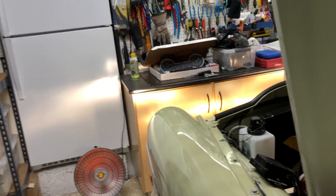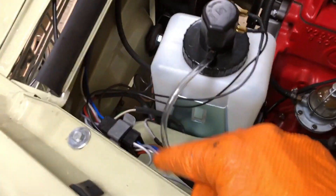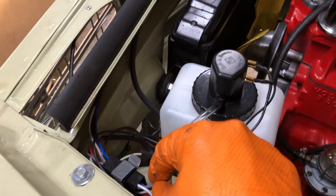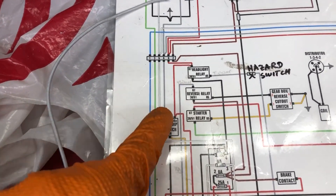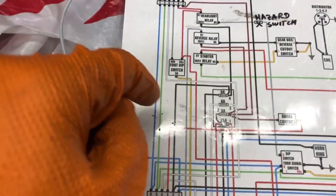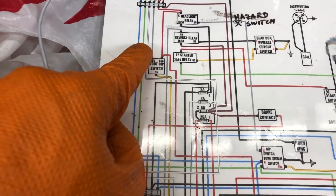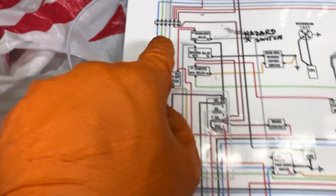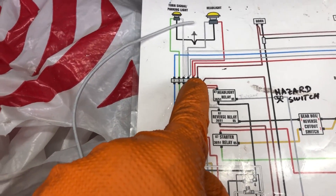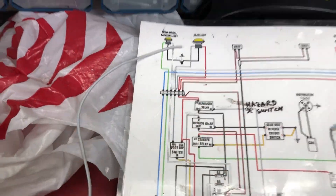Let's go turn these on and look underneath. The two whites — one of them goes to the gray wire. That's the important thing. If you want your trigger, this is where you can find it, or you find it underneath the kick panel switch, which is the foot dip switch. I've connected it here to number four because it was easier to get access that way and I didn't want to pull back the carpet. That's probably an easier method if you've got carpet that's easily removable. You can't go to the relay for the headlights because that gray wire goes to something else entirely. If you connect to the reds, your fog lights will turn on with the high beams only. The power cycles between the grays and the reds — between low beam, high beam, low beam, high beam.